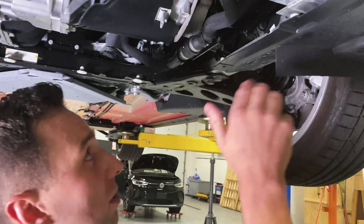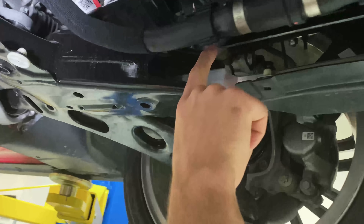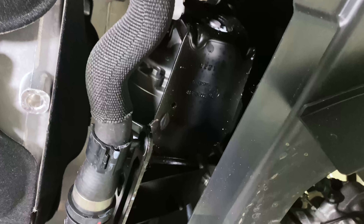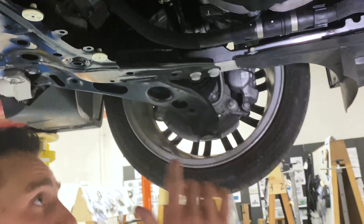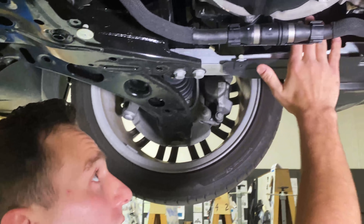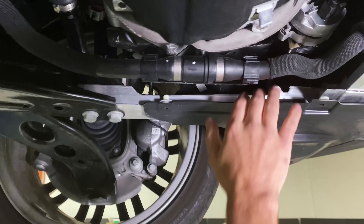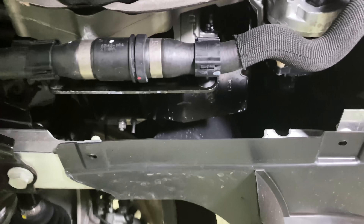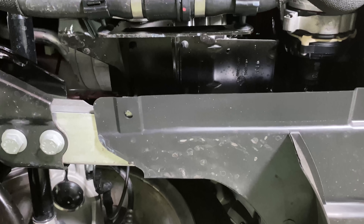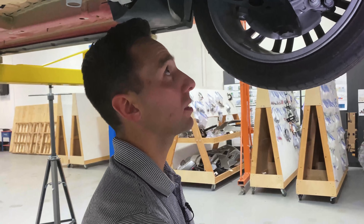Along the lines of EV components, their EAC compressor is packaged right up in here. Working with many of our clients, this is always one of those things you want packaged in the frunk or engine bay area. But since it has high voltage cabling going to it, you really want to protect it so you don't have any thermal issues. The steel bracket it's mounted to is probably every bit of three millimeters thick — not too atypical, but there's clearly an effort to protect that component.